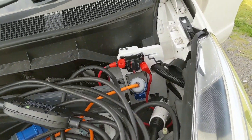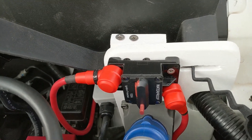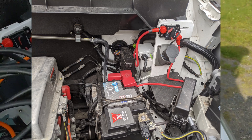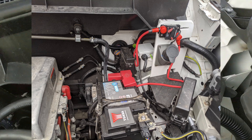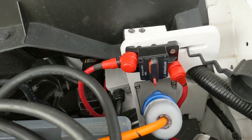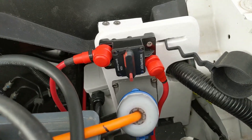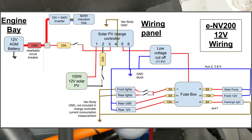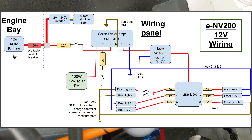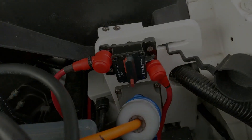If you look into the bonnet of the van here — that's all our charging cables, and over here are the new high-current cables I ran to the battery. I have a positive and a negative to the 12 volt battery, just because I wasn't confident of finding a really strong ground connection in the rear of the van. I connected it through a 100 amp resettable trip — this is better than a fuse because if it does trip I can easily reset it. The cable is 16 millimetre cable, which is rated to 110 amps.